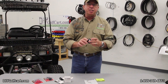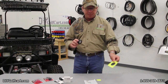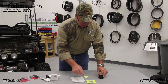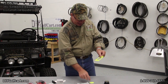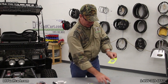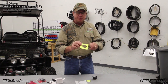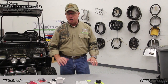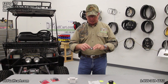Now, this one does not come with a template. So what I've done — I've got a small piece of paper, laid it down face first, drew around it, then on the inside I made another circle one-eighth of an inch all the way around, cut it out, and then it will fit perfectly through. That way you can take this portion, mount it wherever you want on your golf cart, and have it working in no time. But for now, let's get this battery indicator mounted in this car and run the wiring so we can see just how charged these batteries are.